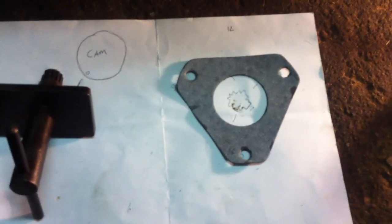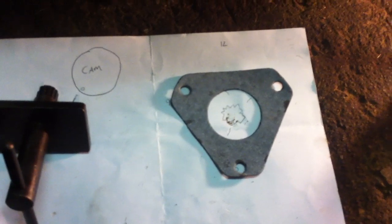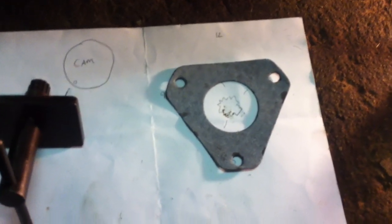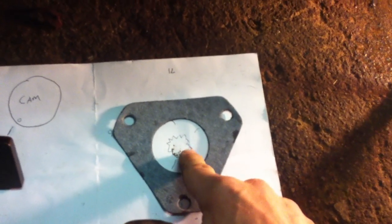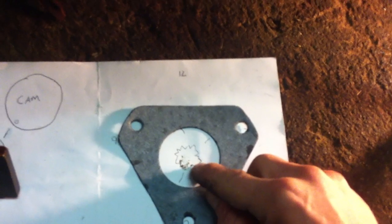This isn't dynamic timing. With an engine this old, unless you're going to use an injector strobe light, the best you can do is this and then tune by ear. So, fairly simple — 5 o'clock on the main drive. You'll know it on the master spline because the master spline is like two teeth in one — it's just a wider cutout, basically.